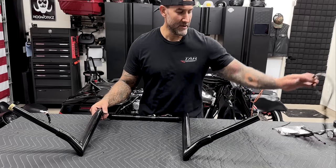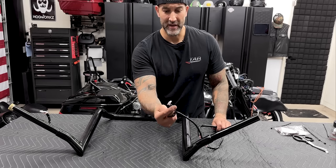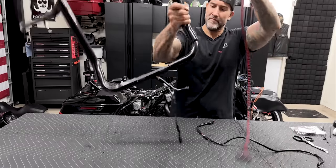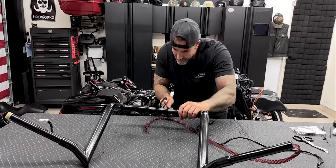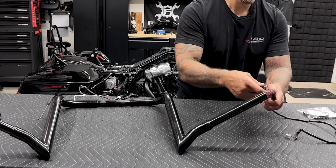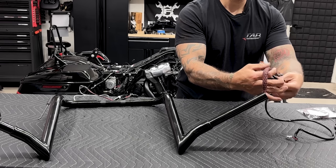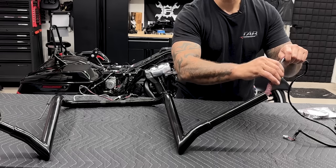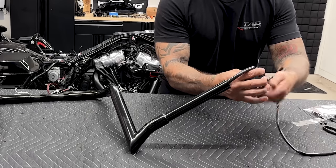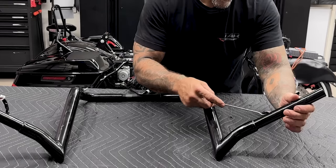Now run the wiring on the left side — this is the easier side, you just have one harness to worry about. When running it through, make sure you have the white connector that goes to the switch housing and left-hand control module running up. Stick the wire into the braided sleeve, tape up the end — not the connector. Give it a slight tug to make sure it's secured. Tape up the connector to secure it so nothing gets de-pinned. Fish this out — and we're wired up.